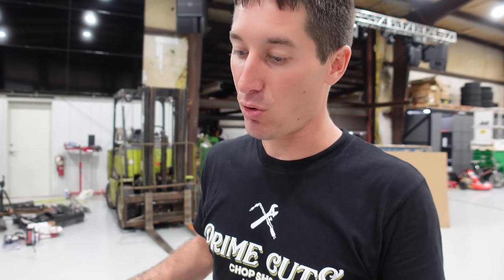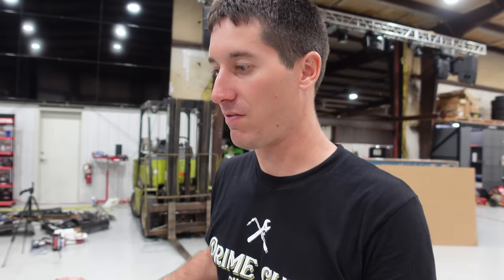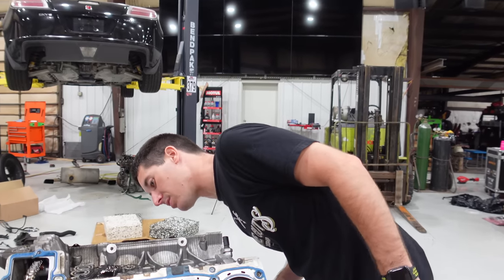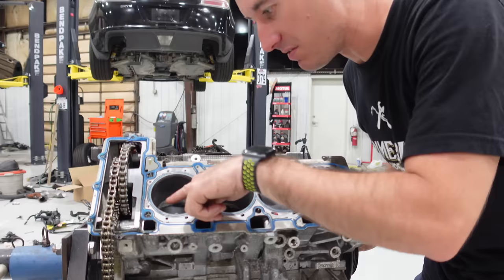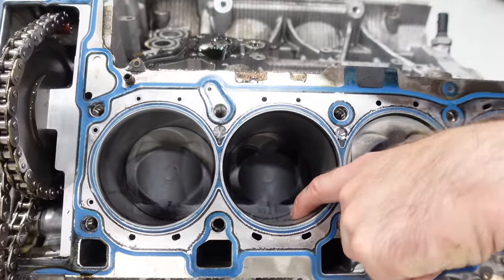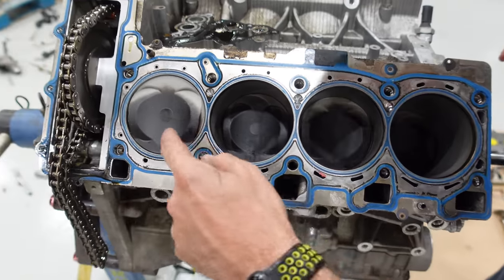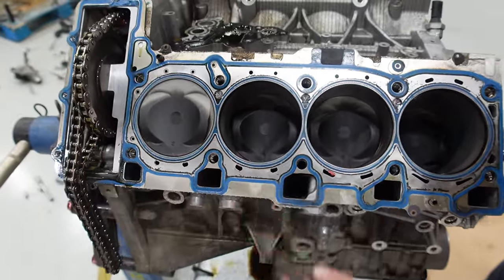This might have been salvageable. The problem all along was there are no replacement pistons. We would have needed oversized pistons, needed to bore the block, and put liners in it — all custom made, which would have cost more time and money than this ever would have made sense. It could have been months of engineering. I feel like I've still made the right decision buying a new engine. All the other bores look brand new; I don't see an issue in any other bore. This one's got a little wetness which is strange; I honestly think this one got hurt the worst. There's a little bit of silvering at the bottom, and this one turned white where it probably leaned out. The other cylinders have some carbon deposits but look pretty normal — that one's white and the head was white as well.